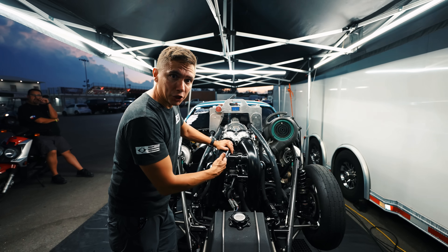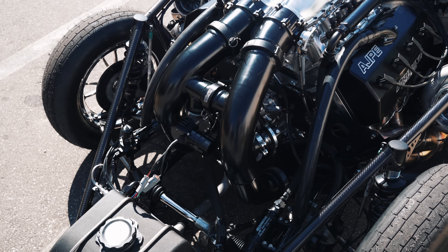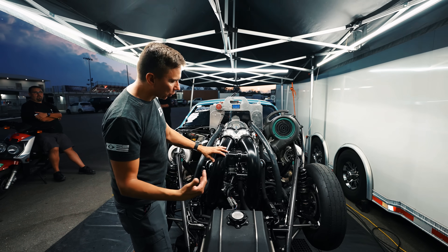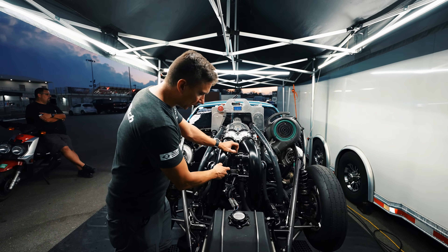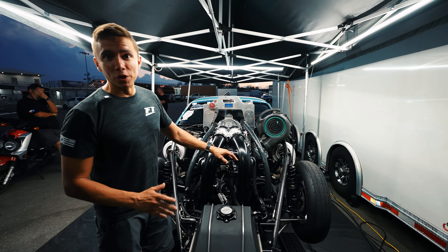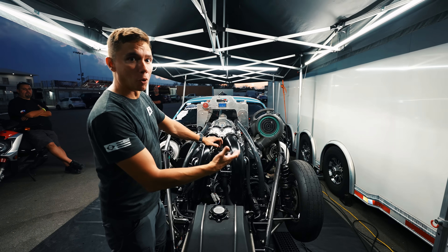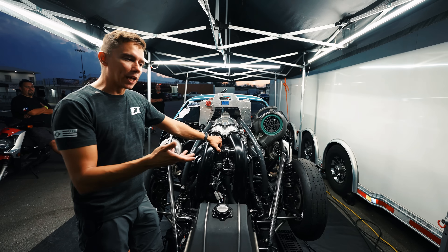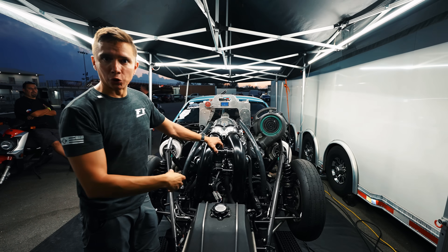We have a gate that would usually be like a wastegate on an exhaust, but it's actually placed on the charge pipe. What does this do? It allows you to run a better boost curve. When you spool the turbo, it's making a lot of air trying to go inside the motor. If you don't have enough, it doesn't leave the line; if you have too much, it's hard to manipulate. This little thing allows you to leak some air and create a better boost curve. In the end, you want to close it — you don't want to run it open. It's only open early in the run so you can manipulate boost, and the behavior gives it a feel like a supercharger. The curve becomes closer to a supercharger — it's higher on the leave, nicer and flat all the way to your max boost.